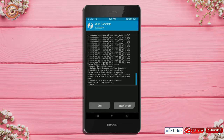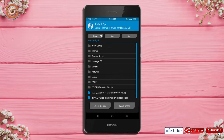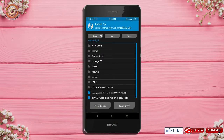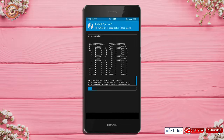We need to go here to install the ROM. Press back and you may find install. Select Oreo 8.1. Friends, here I have provided the latest version of the custom ROM and GApps which are suitable for your device. Please find the links in the description below and download them. After selecting the Oreo 8.1 ROM, swipe right to install.